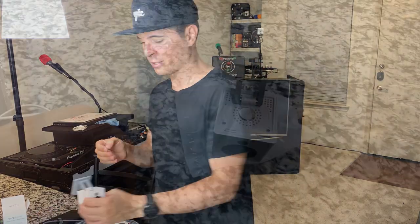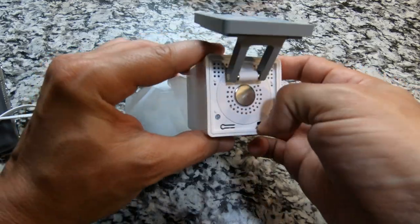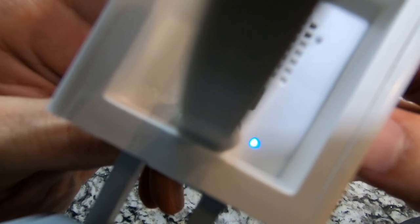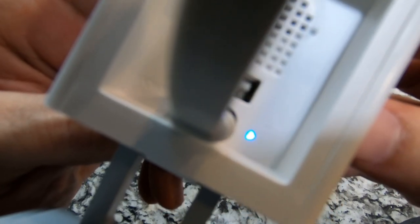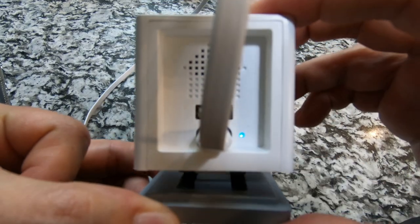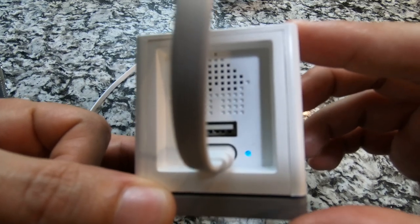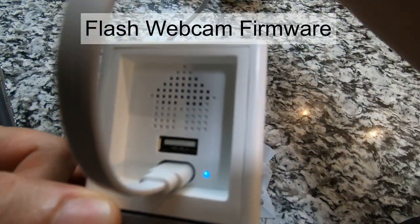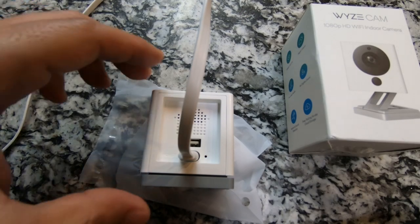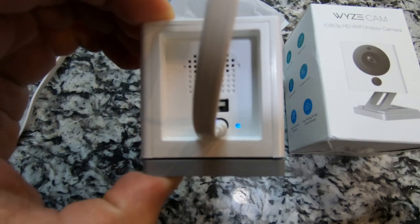Then from the card — so now we have the SD card — we're going to push it in, then hold this button. It's going to go from yellow to blue. You let it do its thing. When it's done, it should be a webcam. You do not need to leave the SD card inside the camera — you can take it out and then flash the other one if you have that. When it's blinking blue, that means it's ready as a webcam.